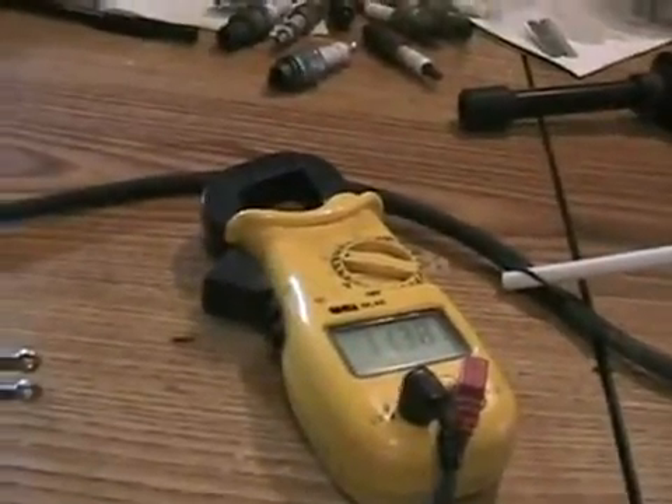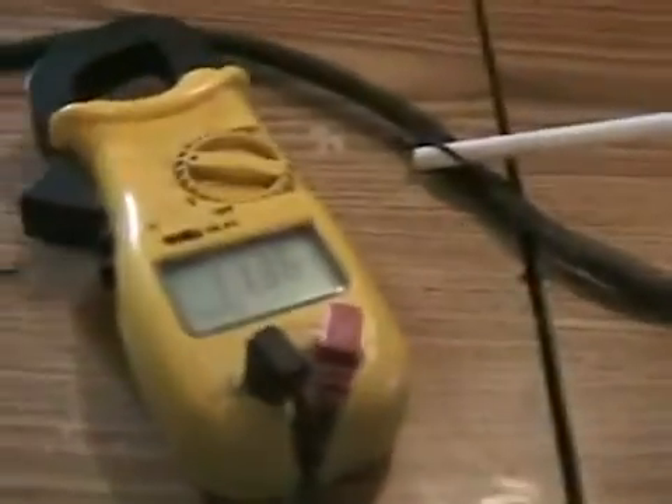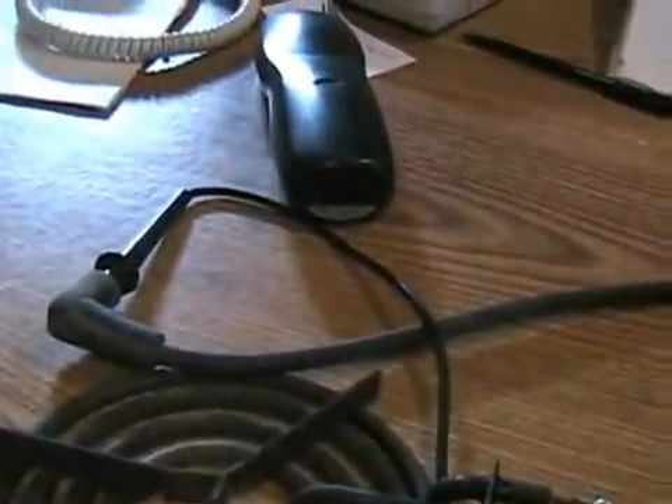That's at the borderline of being good. The way I judge spark plug wires: if they're under 12K, they're considered good. Of course it depends on the length of the wire too. The longer the wire, the higher the resistance; the shorter the wire, the lower the resistance. If this was a very short spark plug wire, the resistance might only be 3 or 4K.